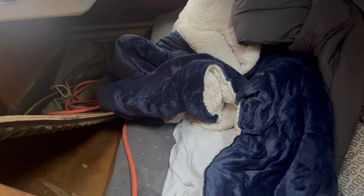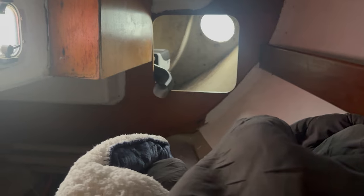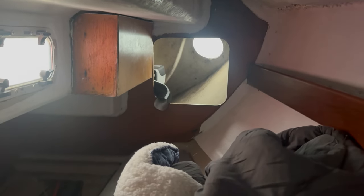This is where the pipe comes out and there is this tap, which actually does work even though it's looking a bit worse for wear. That's the on-off tap, and then it's just connected to here. But this is blocked somewhere and it's all fiberglassed in really neatly. My plan is to run a new pipe in the corner down there and through, rather than chasing it through here. It goes into there, so I've got to basically route this and clip it safely. The diesel heater — you can just see it, it's mounted in there. I've got to drill a hole so that the air pipe goes straight through rather than kink like that, because I want to put that hatch back on at some point.